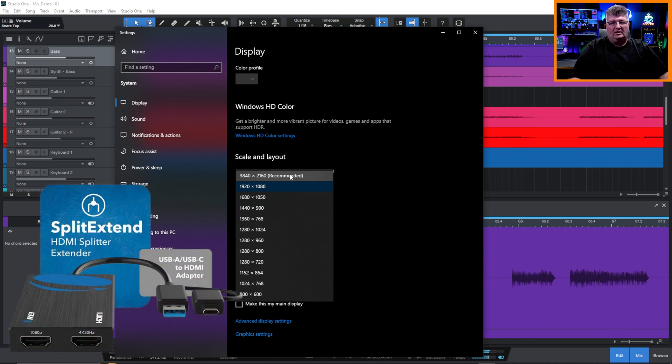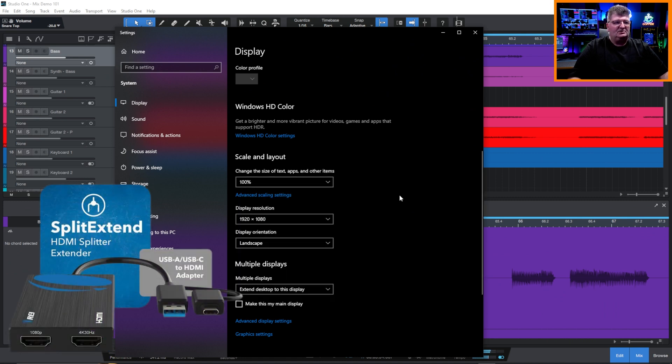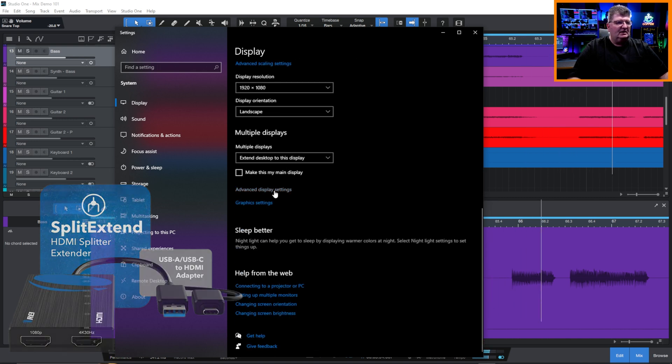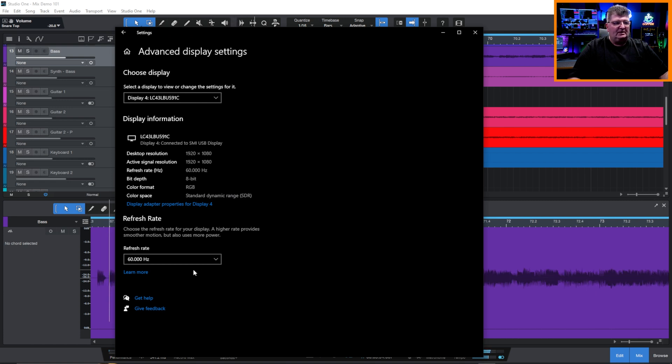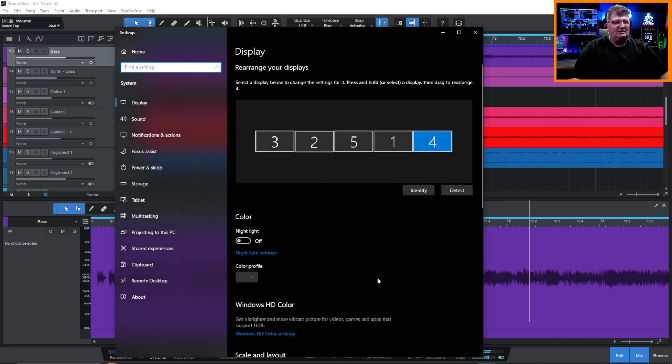This adapter allows us to run one monitor at 4K. I choose 1080p — it just fits my workflow a little better. The other reason is that for video reasons in the studio, if I'm on 1080p I can run that at 60 hertz. But as soon as I switch down to 4K, it's going to give me 30 hertz, which could cause potential flicker with the camera. So if you don't have a camera running it doesn't matter, but that's just something to be aware of.